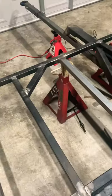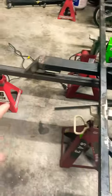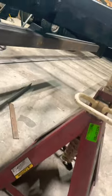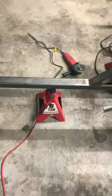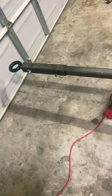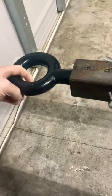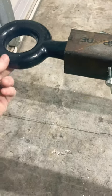I wanted to extend it, so I added the box further, which meant I had to cut off the original coupler. Because the trailer is now lifted a lot higher with the spindle axles and the Jeep tires, I dropped my new hitch — the tongue — to the bottom and welded it. It's two-by-two connected there. I kind of like the idea of being able to take the hitch out so no one can steal it — I don't have to get a fancy lock; I can just remove it if I leave it outside.